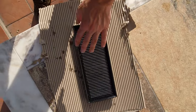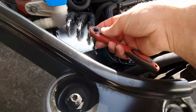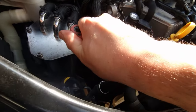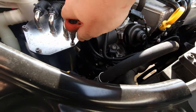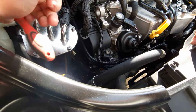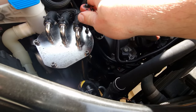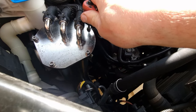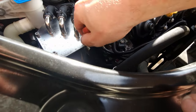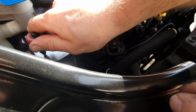The air filter will dry very quickly because the air is hot today. Now we remove the fuel filter while we let the oil drain until it stops dripping. Here we also have the newton metres - it's 5 plus/minus 1, so 5 newton metres, with these tiny M5 screws.